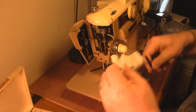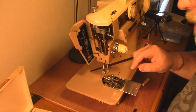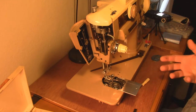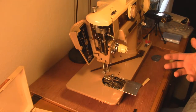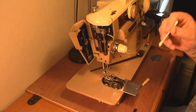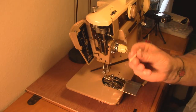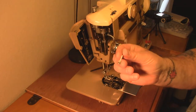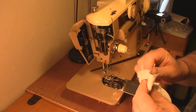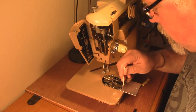For this machine being so old and as used as it was, it's in remarkably good shape. Down in here it is filthy, but the good thing about Q-tips is you can wipe down with them, and they're also really good at grabbing dust and fiber. Look at all the crud it'll pull out of there - that's pretty good. That stuff is all waiting in there to jam up your machine and screw up your thread.